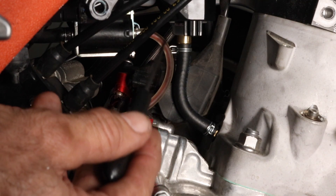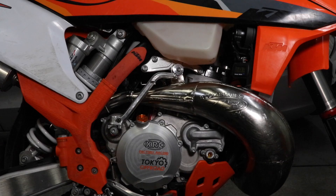When you've reinstalled everything, check all your electrical connections — the pressure sensors and the oil pump. If you disconnected the oil pump, reconnect it and connect up the hose, making sure there are no air bubbles in the oil hose. If there are bubbles, you can flush them out using the dongle. The bike is fully assembled now — I did a quick test start and it starts and idles fine, but I won't really know whether the crankcase pressure sensor is fully fixed until I give it a proper ride.